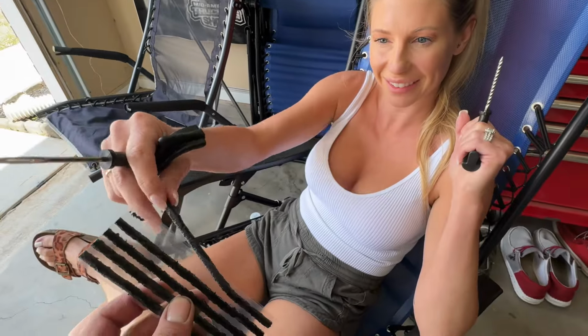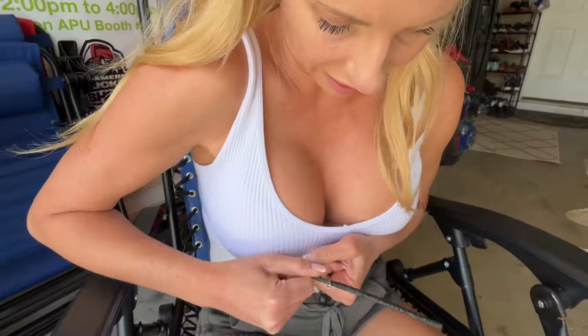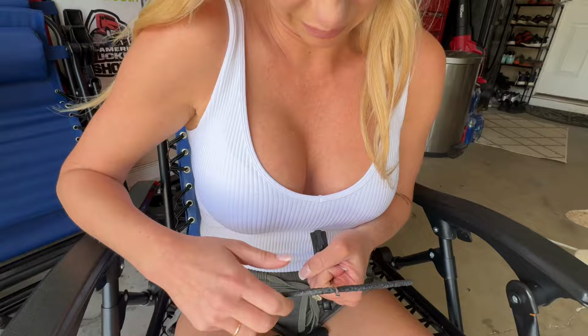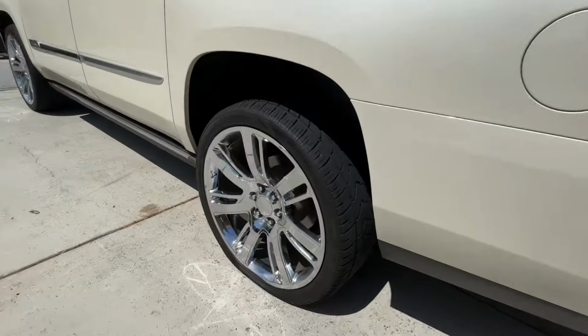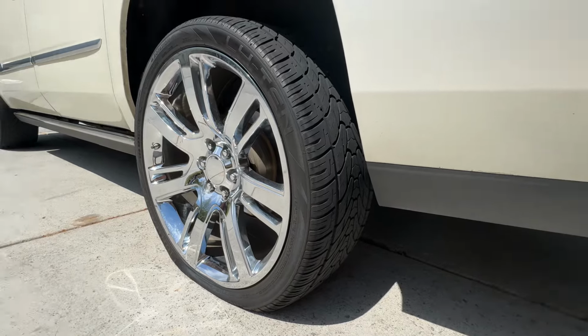So first you take your left hand. Left hand, babe. And you clean the hole out. And then you take this little sticky guy, pull one of those out. There you go. And you're going to slide it through the little hole like sewing. In case you've never done this, guys, you also want to have your tire deflated before you do this. I guess I'm putting it in the center. Kind of hard to pull it through, right in the center. But there you go. What you want. Come on, Dubs. Definitely have your tire deflated first. I know that seems simple, but some people might not know that.